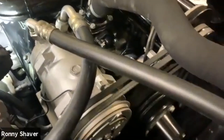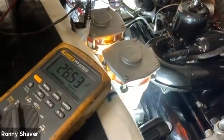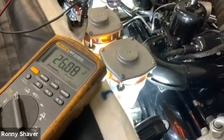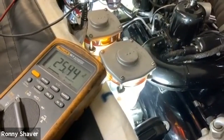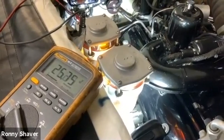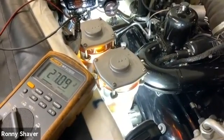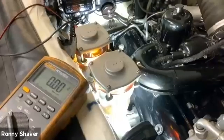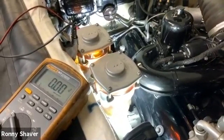Look at the voltage — we have 20 volts. So that generator toward 24 volts will put out a lot of volts. What does it say? If the generator builds up normal voltage... I don't know what that means, it seems like a lot to me. I don't know what normal voltage should be. That seems high — normal voltage to me would be around 13, maybe 14 volts.